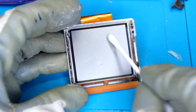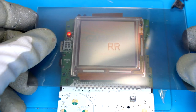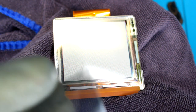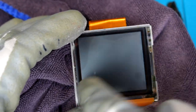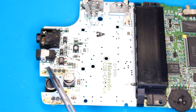I'm just cleaning up the last bit of the screen now. This took a lot longer and was a lot tougher than I expected, but it's now ready. Just to make sure the screen works and to confirm the right orientation for the new filter, I'm turning it on and placing it over — we can see the Game Boy logo. I'm going to cut the filter to size, peel off the sticky adhesive layer, and carefully stick it on. It's done again this time with no bubbles, perfectly clean. Let's turn it on — and there's no bubble now.